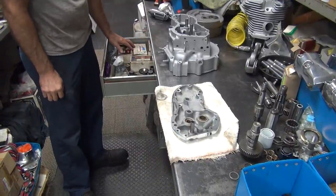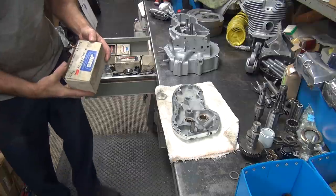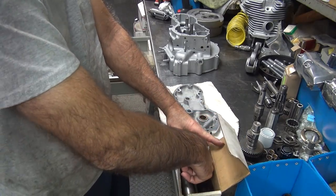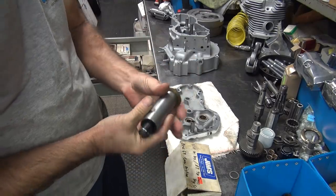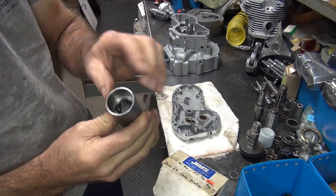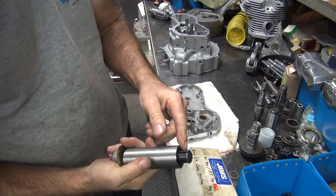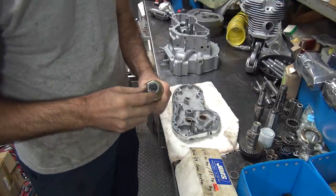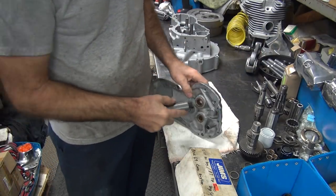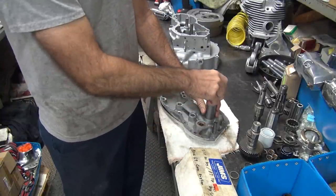Let's see what we've got to do here to pull this apart. This is my pre-69 cam bushing — this is 67, so that'd be pre. This is one of those Jim's tools I modified. For the cam, I use the one I made. Mine I can use for more than one thing, like pulling these bushings out. This is made to pull out the primary bearing — the electric start primary bearing. It is not made to pull out the cam bearings. I made it so it works. It goes in like that, drops in there, and that should pull it out.